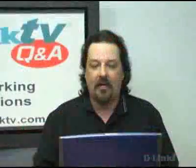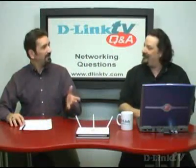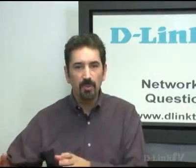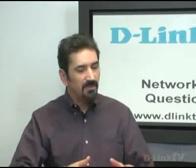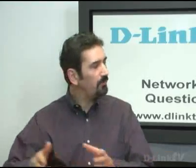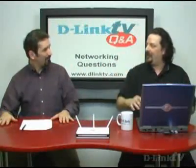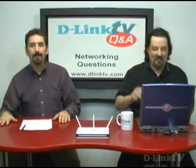Mike from Ottawa, Kansas wants to know: can he connect an eight-port switch to the DIR-615 router and use the switch ports for PCs and the router ports for a network-attached storage device? This is similar to the earlier question but more specific. As you cascade more switches, it doesn't really matter what you plug in — whether it's right into the router or a switch, it's just like one big switch. So plug them in wherever it's convenient. Kind of like Legos — it just keeps building until you have hundreds or thousands of ports.